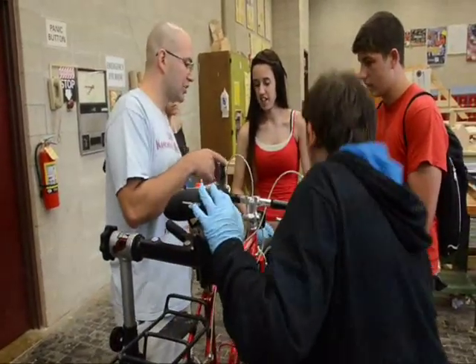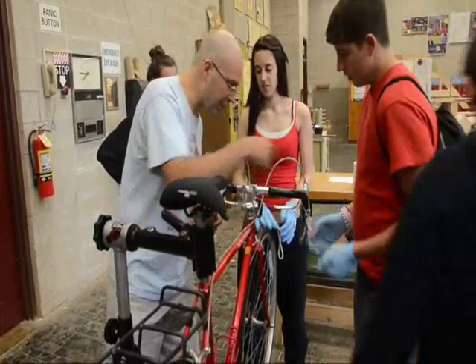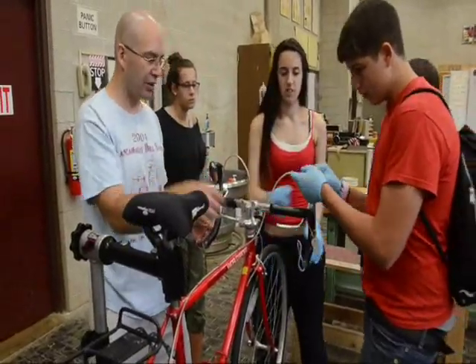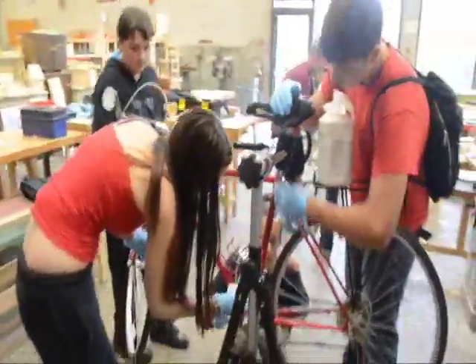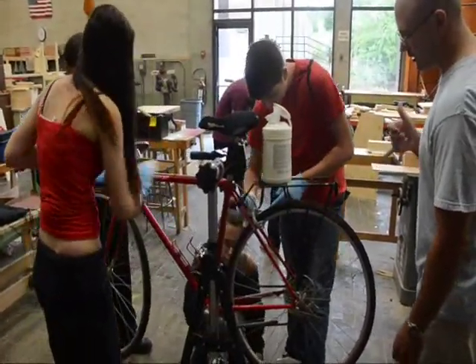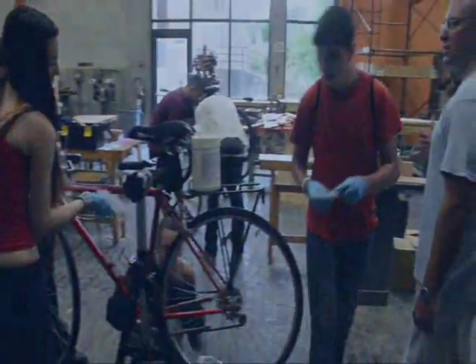How do you tighten it? Actually, you know what — let's look. What we're going to do is take our brake cable and follow it. We're going to look for any barrel adjusters, any kind of adjustment. Next thing we're going to do is double check the derailers and check the brakes again. They feel fine? All right, I'll go through and give them my final check. Then we'll lube up the chain and I think this bike's done. Yeah, this one didn't need much.